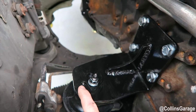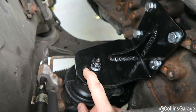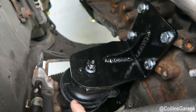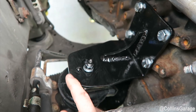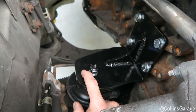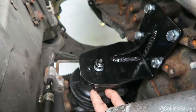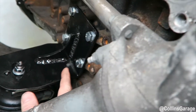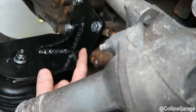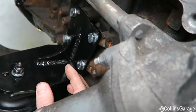One thing you won't find on yours is this pin relief hole — that's not going to exist on your mount when you get it. You're going to have to cut the pin off of the stock mount. The instructions will have you cut the stock locating pin off of the stock 350Z isolator. But essentially it's gusseted, laser cut, and there are reliefs to go up and down with the mount. You can see ours is adjusted midway on the mount to make sure you get it perfectly level on your swap.